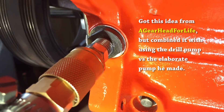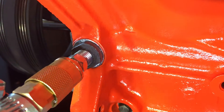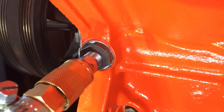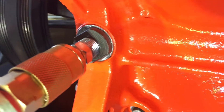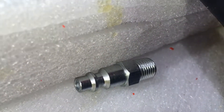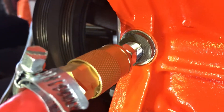That is an oil galley plug — it's a solid plug but it's an M16 by 1.5 thread into the block. I couldn't find an M16 to save my life, so I ended up going to the dealership and buying a replacement plug, drilling a hole in it, and then tapping it to get this male fitting on it. That fitting right there is what's coming out of there — the male end is in the female end of the plug which I tapped out.